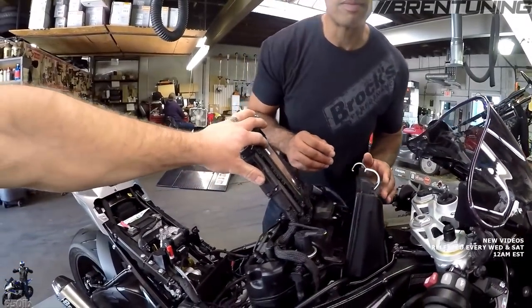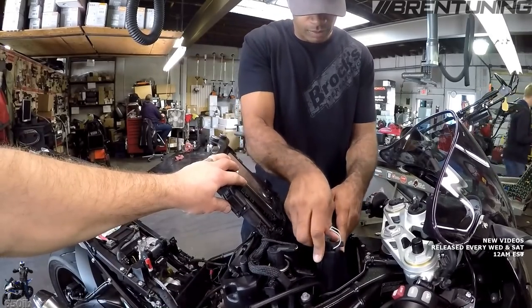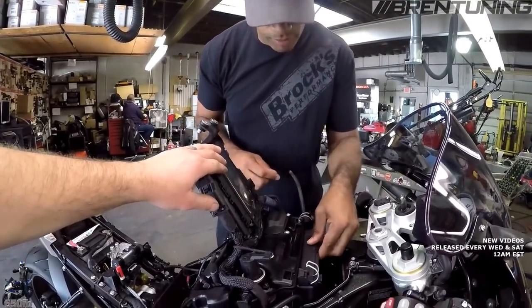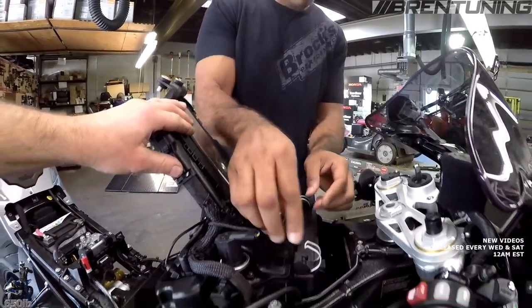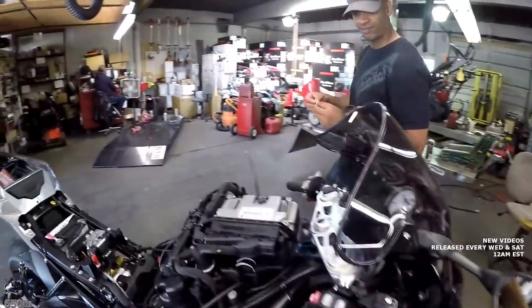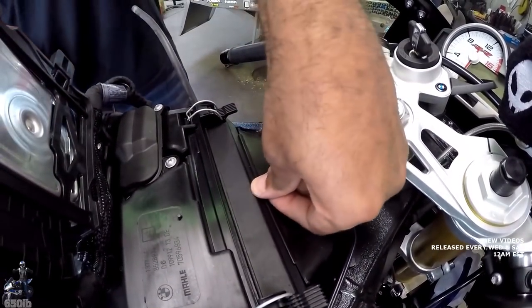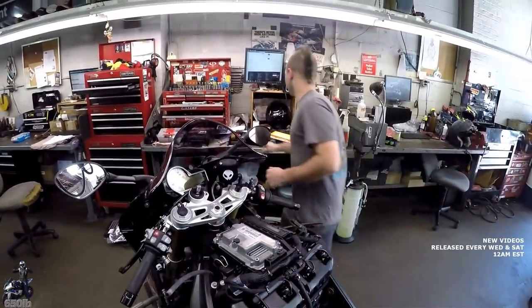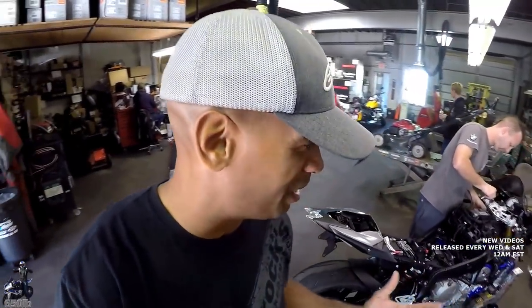Make sure the hose on the outside of the cage is positioned correctly, then slide it in. One clip is already in the right position — flip it forward, stick the first part in, lock it, then push the second part in and it should click to lock. Mounting the ECM back up can be a little tricky — the plastic doesn't always want to fit nicely.